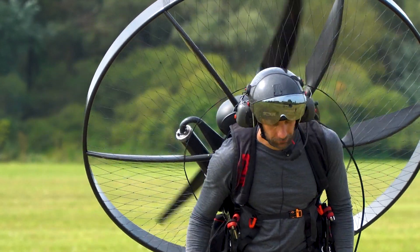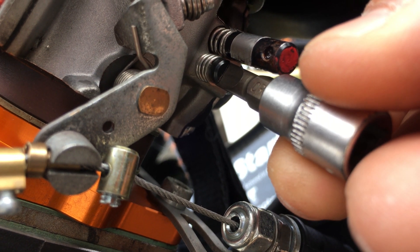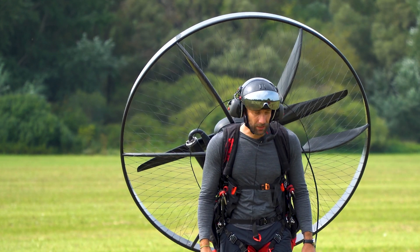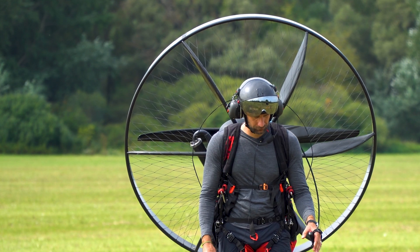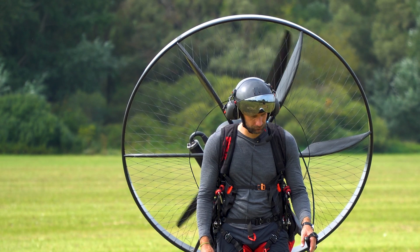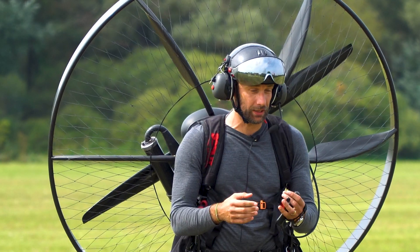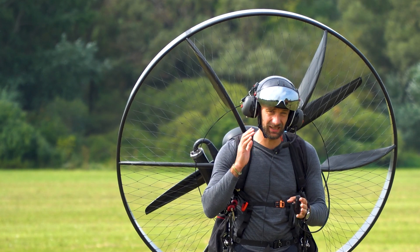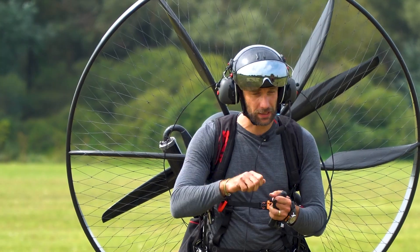Still good. Another minute, please. Now it sounds about right. It sounded pretty good and I didn't have to hold the lever anymore to keep it idling. So it seems like this would be the good setting — but to be sure, let's do one more step, and that is close the low needle again.